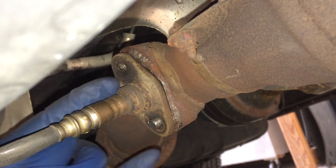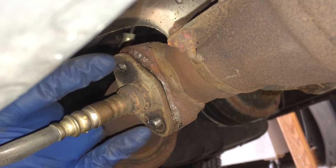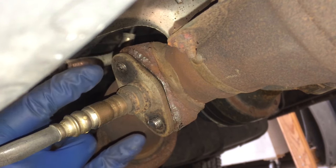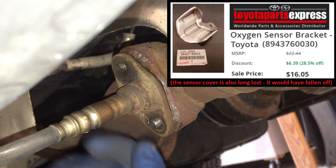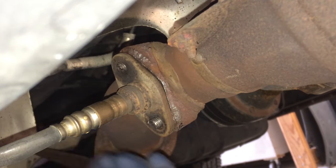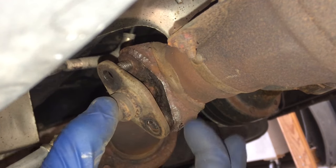This was real rusty. There wasn't anything left of the stud here — it's just like that. Same deal here. This had two locking nuts on it and they just rusted out. They didn't just lose the nuts; they rusted and took those whole studs with them. They probably rusted out a little bit, then there was vibration that weakened the stud. This ought to have a gasket here too, and the gasket's gone as well.